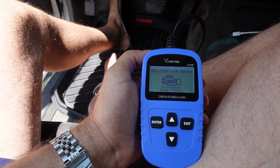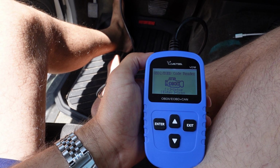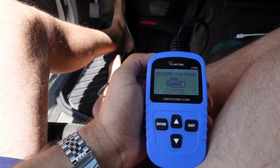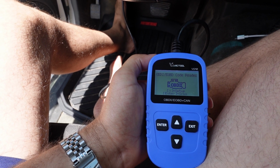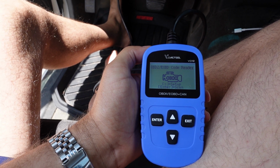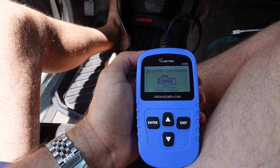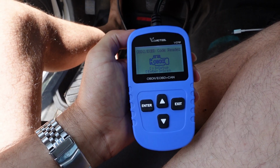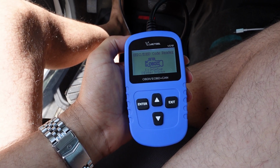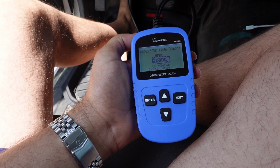Well, for a couple of reasons. First reason is that maybe there's a new person trying to get into DIY that's really budget-minded. And second of all, if you are, say, an advanced DIY, maybe you just want to help a family or friend out, and they keep telling you they have this intermittent problem. Well, this can go for professionals as well. They'd say, I don't know when this problem is going to pop up. And then you can say, I tell you what, take this code reader right here with you. When you have a problem, plug it in, go to the live data, show them how to do that, and take pictures of it, or even video chat, and you kind of give them a live session with you. And you can help them resolve the issue.